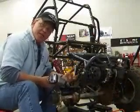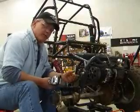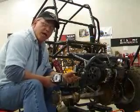The variator is one of the easiest and cheapest things to upgrade. You can get a lot more low-end torque out of it, or even raise the top end a little bit, depending on the type of sliders or weight sliders that you put in there.